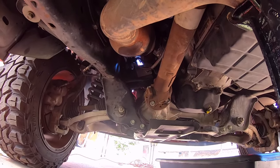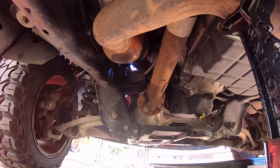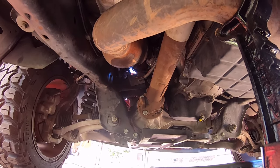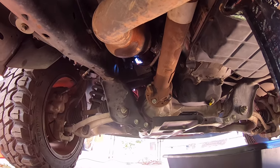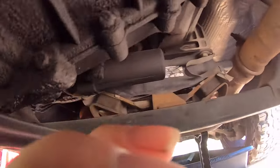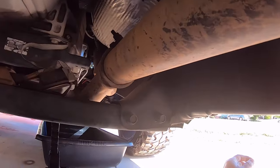With that being said, we're going to continue working on getting the valve covers back off, get the rocker shafts off, and then obviously the next step will be breaking the head bolts loose and then pulling the cylinder heads to see what kind of carnage is waiting for us on the other side.